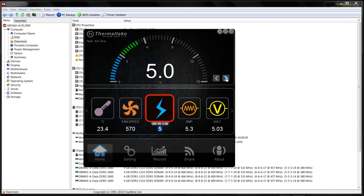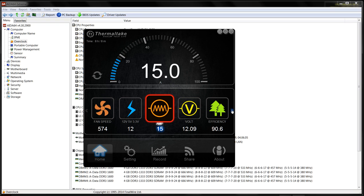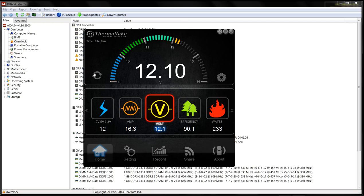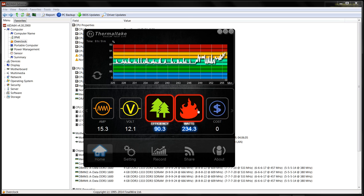The 5 volt rail is a little over 5 amps, and the 3.3 volt rail is back to normal. Here's our wattage - you can go back in here and peruse records and all that. You can see a timeline visual and here's the efficiency graph. As more load is placed on the power supply, efficiency increases - I've seen this go as high as 92.5 percent.